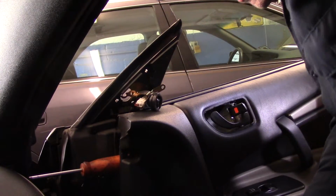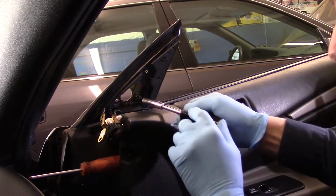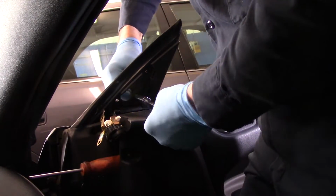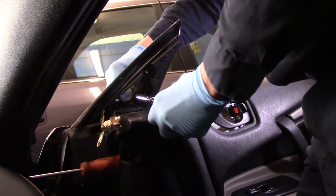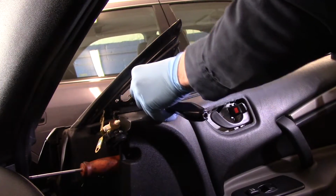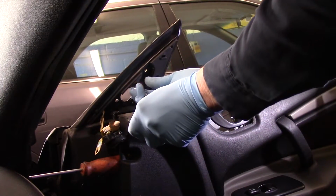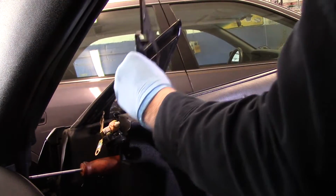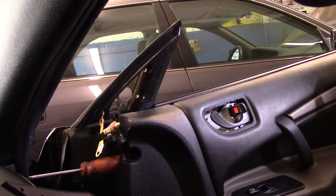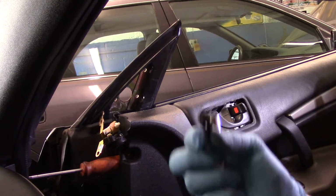Now the nuts we need, the screws that actually hold it in place we do not need. This we're just going to move to the side for now, just like this. And then we're going to remove the last 10mm for that stud. Alright. Remember, we're going to use this piece over again. This has to go back on because that holds the beauty ring on the inside here. So we're going to put this off to the side for now, but we are going to use this again. The nut we're going to hold on to, but the stud that broke off we're going to throw away.